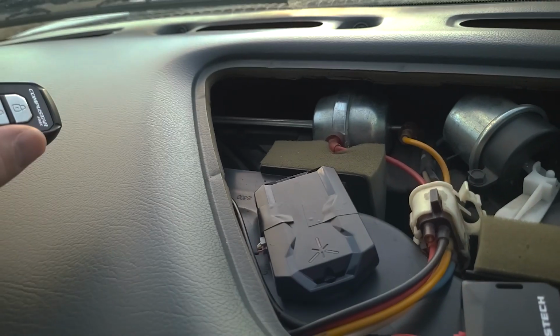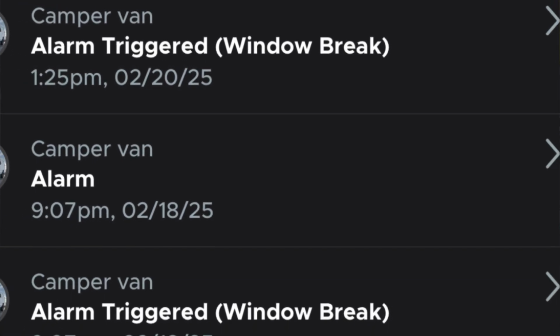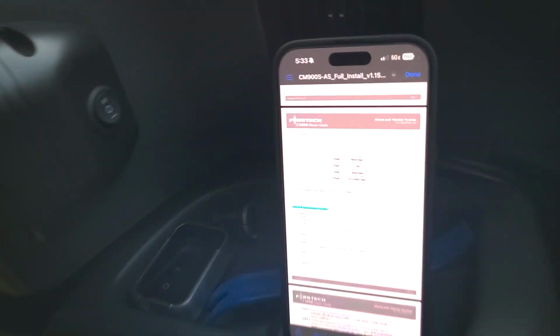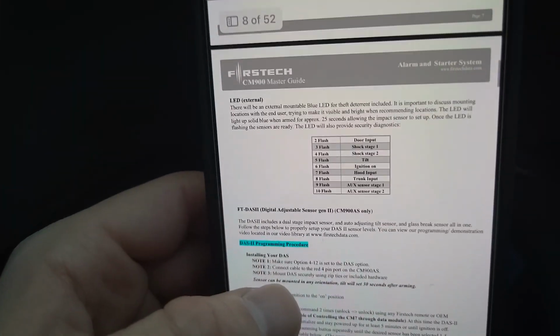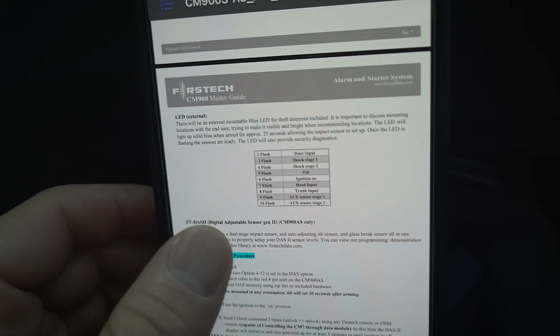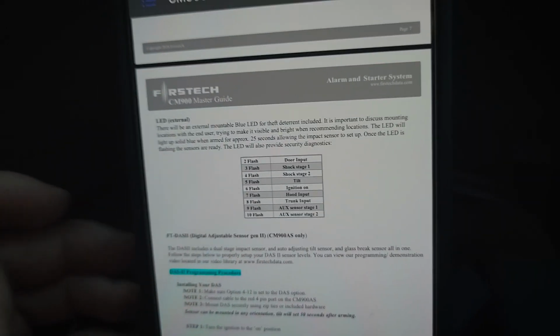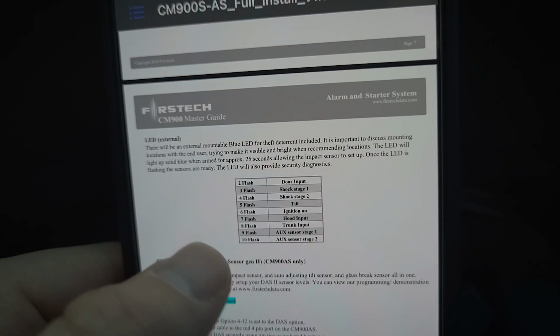If you have one of those installed, it'll just show you in the activity history what happened and when. But even if you don't have the Drone Mobile app, there is a way to tell. I would definitely get the instructions for your alarm system. I'll try to leave a link in the description below. But basically, the little blue LED that flashes every so often will tell you exactly what sensor was tripped.